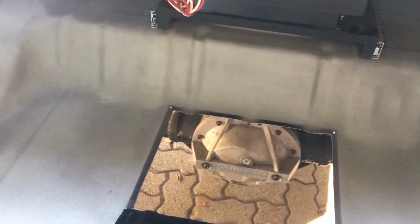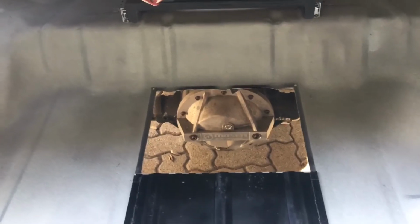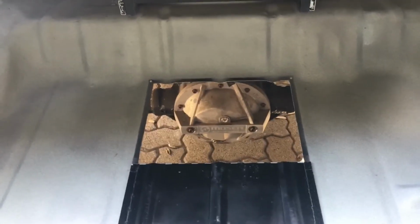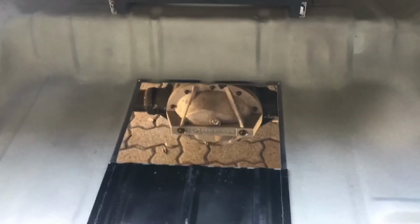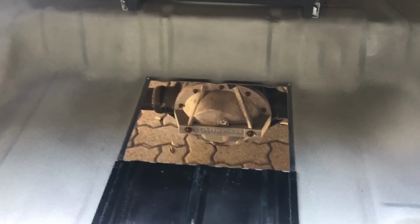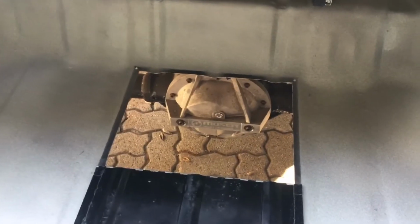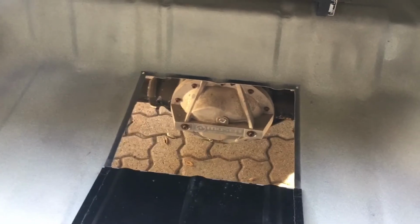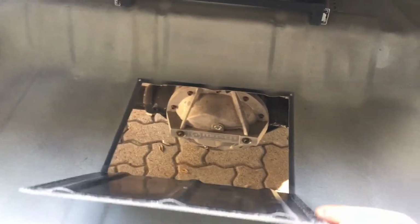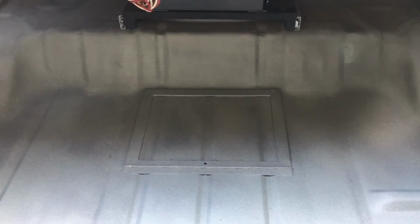So once the tank is in, it gives you easy access to service the pump if needed, as opposed to having to pull the gas tank out to access it, which is a real hassle on an A-body, especially if you run the exhaust over the axles and out the back. It's doable, but I'm running larger exhaust, and I would rather not have to pull exhaust to get to the fuel tank if I ever need to service the pump. So, trapdoor went in. First Chevelle had the same detail, has been handy on one occasion, and so I decided to do it again on this.